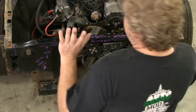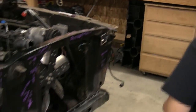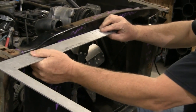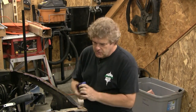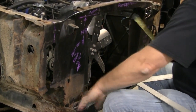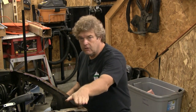Now I want to talk about the front of the core support because we're doing things a little differently than just replacing the apron and cross piece. I'm going to grab my stool and my straight edge. I want to put the straight edge in here, make a mark across and down, then measure that distance. The apron from that position is 16 and 5/8 inches long. From here to this line is 16 and 5/8 inches. That becomes really important when we start aligning these two pieces to get them back in the spot they were in before. We want to make sure this is level.